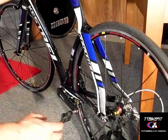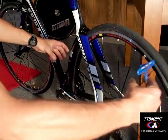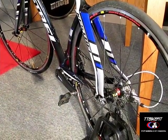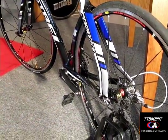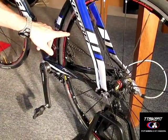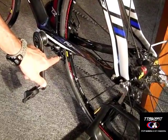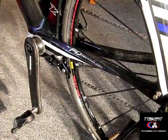You can certainly set it very crooked if you don't pay attention, so make sure the wheel stays centered when you move it in and out. These should be torqued to about 8 Newton meters if you have a torque wrench — fairly snug for a 4mm screw since you obviously don't want it to slip while riding. Also be aware that if you change your back wheel setting, it's going to affect where your brake pads line up with the rim, so you may need to move your brake pads as well.